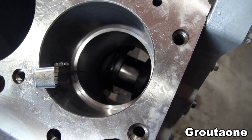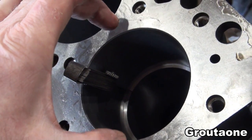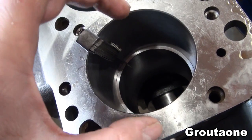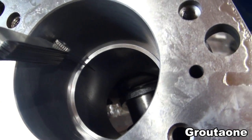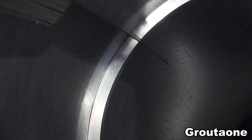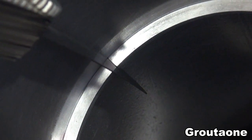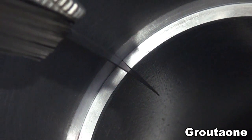I've got one of the top compression rings in the bore now. I just gently squeezed it together, got it started, and then slid it down with a piston to get it squared up in the bore. I checked the shop manual and it showed 16 thou on the minimum and 27 thou on the maximum. I've got 16 thou in there right now — it just nicely fit without forcing it. I'd rather have it closer to 16 than the maximum because that reduces blow-by, having that gap more on the minimum side.